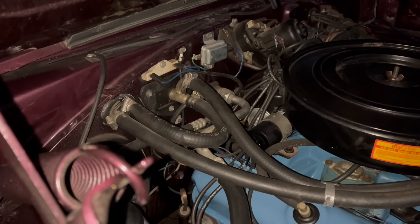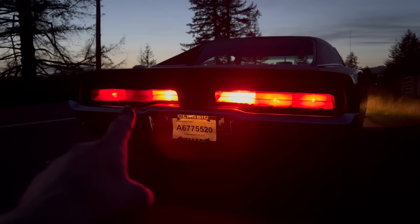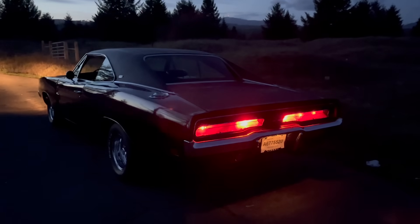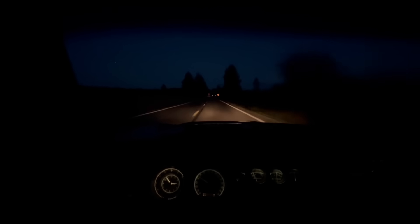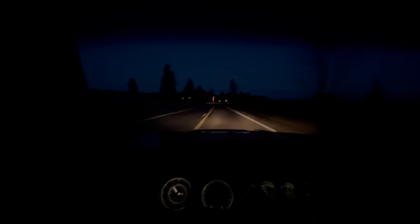We'll take the tiniest little bump back out. I almost always leave distributors just loose enough to be adjusted like this. We lost one — these inner bulbs are supposed to be dimmer than that, but for some reason they never are. Not a bad sounding 318. We gotta test it. Nice. Still a little 318, but so much better. It makes something like the power it should, and I didn't hear any pinging that time. It chirped the tires a little bit.